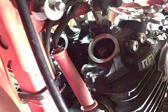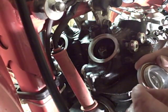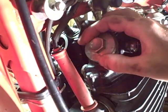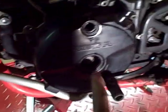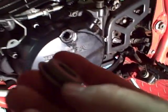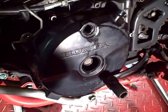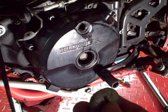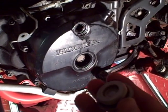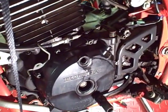After you get all the valves adjusted, reinstall your caps. There are no torque specs on these caps, so just don't go crazy on them. Check the O-rings — make sure they're not cracked and are still flexible. Reinstall the caps on the crankcase as well; they also have O-rings, so make sure those are flexible and not cracked so they don't leak. When you start your bike up after you finish, check for leaks around those caps. And that's pretty much it — I hope you found this video helpful, thank you for watching.